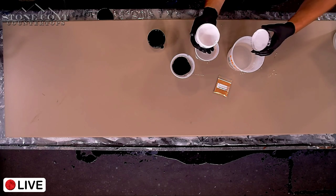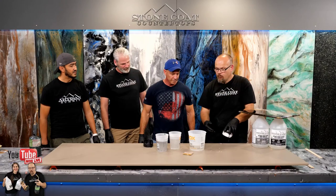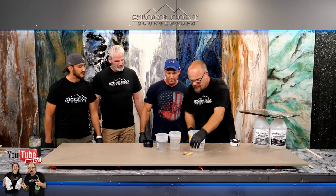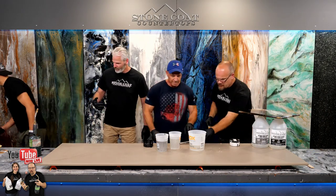I got some white. Don't put too much white. Yeah, you want 2 ounces per quart at the most. That's the proper amount. You don't want to go any more than that. And then we're going to do our gold metallic. You guys want to grab a paint stick and start mixing those.